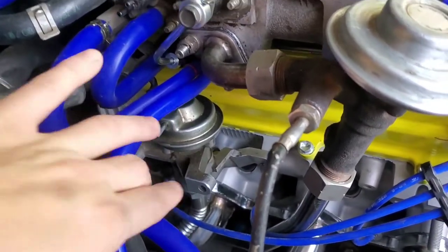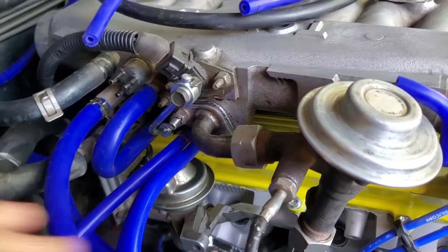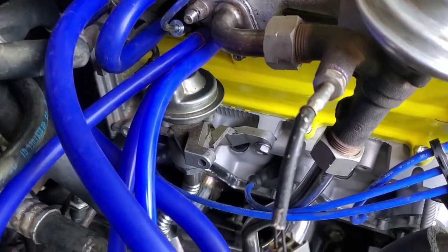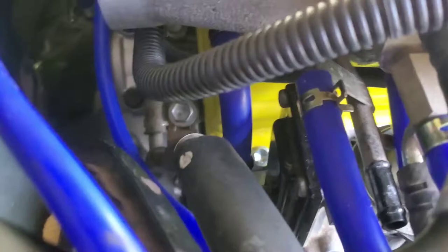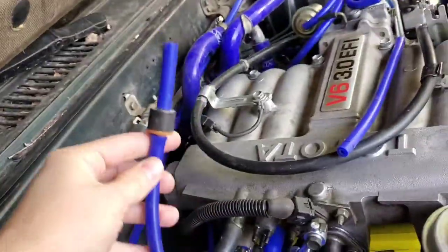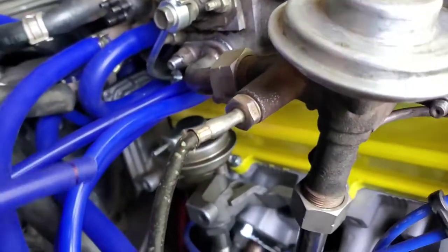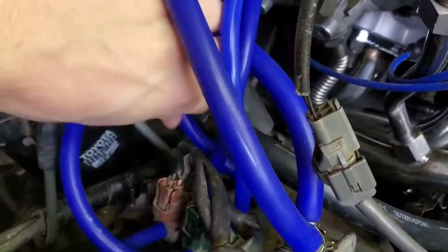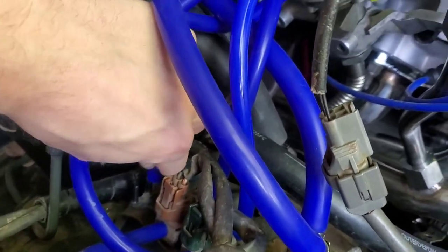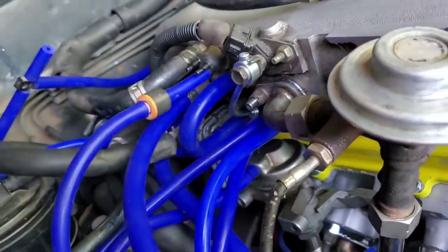We're going to talk about the pair reed valve now. It's down here with a little diaphragm — when the gases get hot or cold enough, the diaphragm pushes down and sucks more air into the engine to burn off harmful gases. There are about three lines going on and off it. One on the backside connects to a little tube that goes up and under into the plenum. Then a check valve line goes into the top nipple and into one of the vacuum tubes. The bottom nipple of the pair reed pulls down and under to the first nipple on the blue valve.